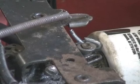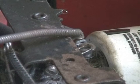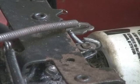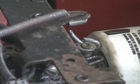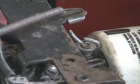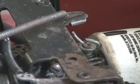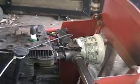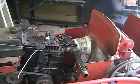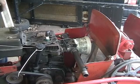It works fairly well. So when you do the choke, go all the way up on your throttle. See that? And it hits that and it closes the choke. Now you should be at high idle there, or high throttle there. And then throw throttle and then off when it hits this wire here. Probably can't see that because I zoom so close in. So, let's give it a shot, shall we? Yeah, it's cold. Choke it up and let's see, all we can do is try, right?